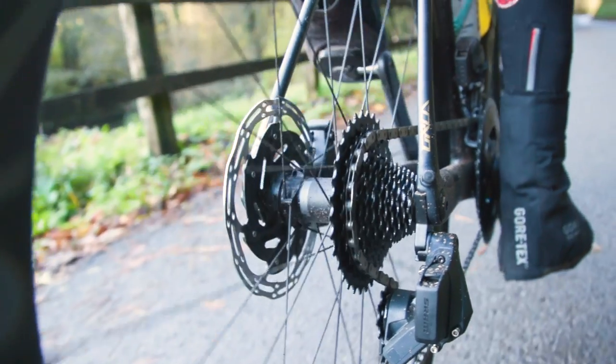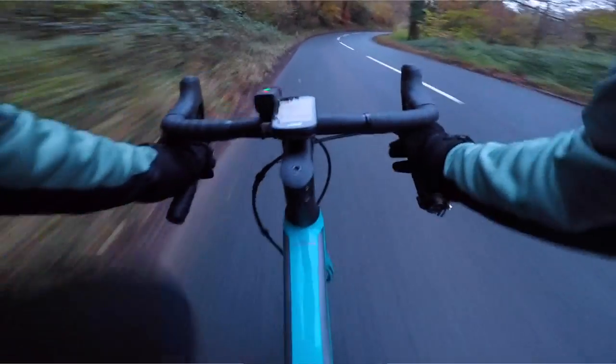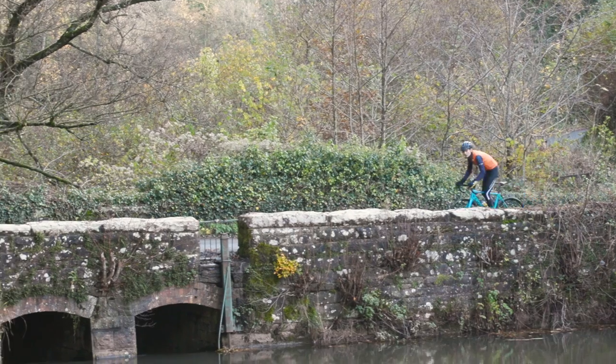I personally have generally always been of the view that I would rather choose when to shift my gears myself. Having said that, I've used the compensation shifting, or semi-synchronized if we're talking Shimano, option quite a bit now. I do actually really like it because when you shift your front derailleur, you just get a very natural next gear. The only downside is if, say, you were cresting a hill and you shift into your big ring, the rear derailleur is going to move in the wrong direction at that point. But in practice, that usually doesn't matter very much.